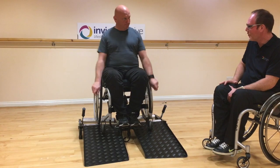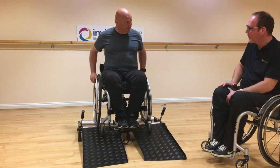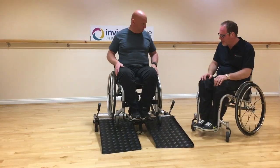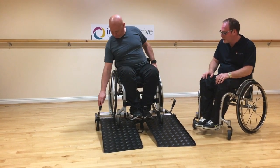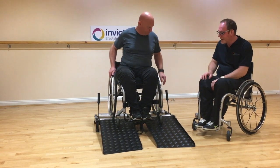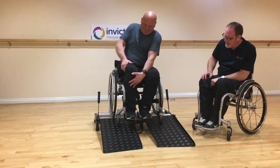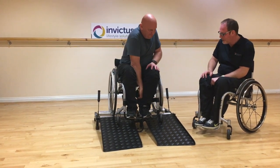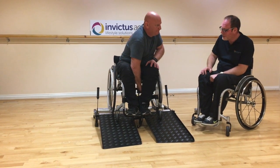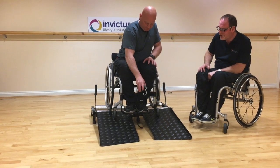Do you know what pressure your tyre should be at? Up to 10 bar, which is 145 PSI. Okay great, let's get off and check that out. First, put both brakes back on in the full up front position. Now the next important thing before you wheel off is to remove your ratchet strap. To do that, reach under your seat — on the back of the ratchet strap there's a little pin. Push that pin down and it'll slacken off one of the ropes and allow you to remove the ratchet strap.